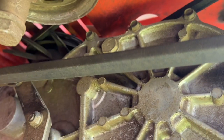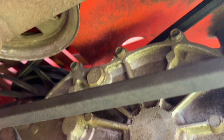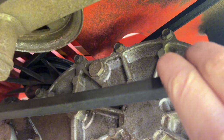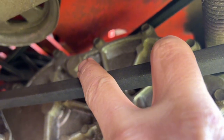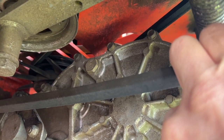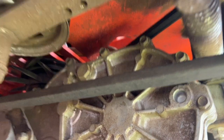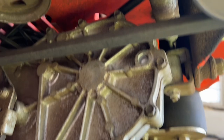That is the vent. If you don't remove that vent bolt, when you go to pour the oil in, it's a really slow process. So if you take that vent out, which also happens to be a self-leveler, you take that bolt out, and when you go to fill the oil, we're going to show you this in detail, but it'll fill to the top, then you know the machine's full and there's no air bubbles in it. So you want to get those out. They're usually always in the same spot, right up there.